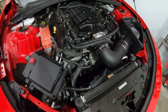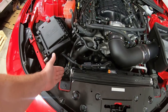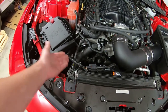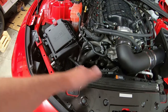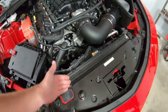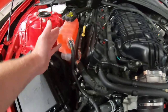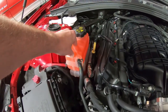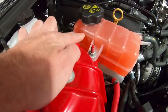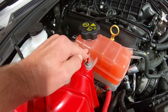So how this works is this is the highest point in the system. Think of this as like your radiator cap. Normally in older systems you had your radiator cap down here, which tended to be maybe the higher point in the system like in a truck. That was okay because if it's the highest point in the system, air can get out and you can bleed the system. With the Camaro, the radiator being lower than the engine causes a problem. So manufacturers add in this surge tank and make it the highest point in the system. That's why if you look on the tank, they have the cold fill line right here — fill this top tank all the way to this fill line, put your cap on.